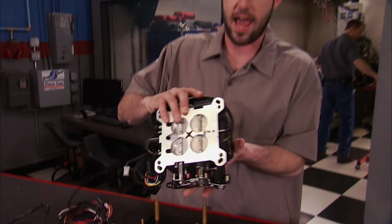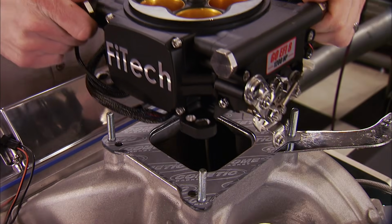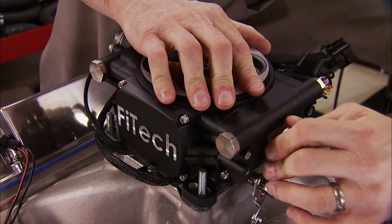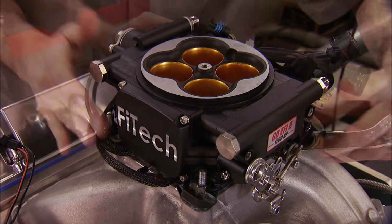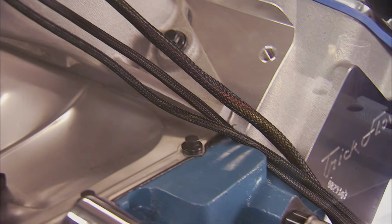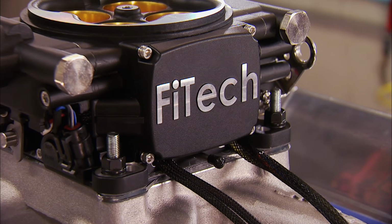Now, that's all thanks to 8 high-flow injectors that are mounted into the throttle body. It's boost ready right out of the box to support up to 25 pounds in a blow-through application or a Roots type supercharger setup. It has a built-in 2.5 bar MAP sensor. The fuel pressure regulator is built in as well, so you won't have to mount a remote one. And the ECU is mounted here to eliminate something else to mount and bulky harnesses to hide. This system also features several important control systems, like a built-in 8-gig data logger, along with boost and nitrous timing retard strategies and air-fuel target options.